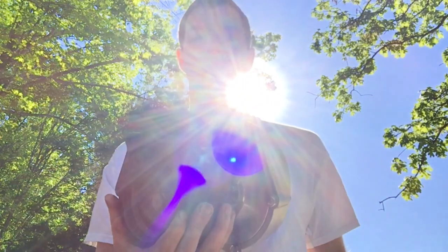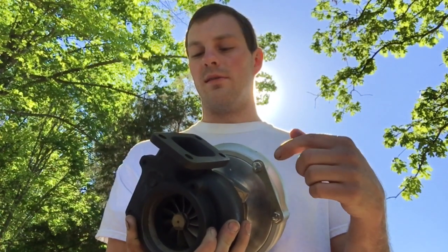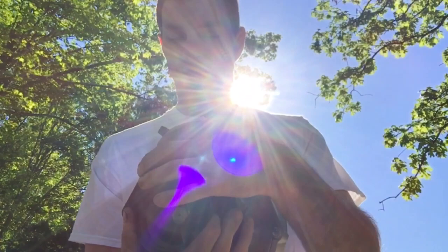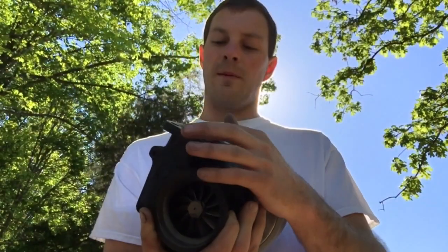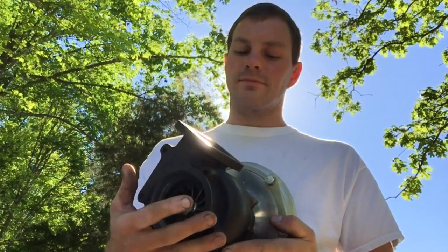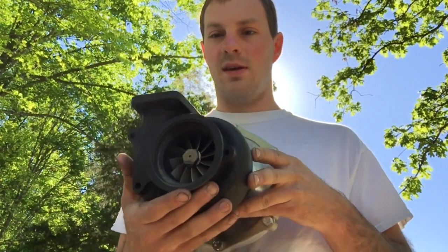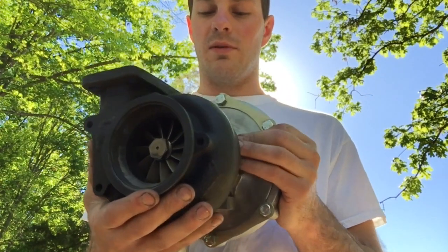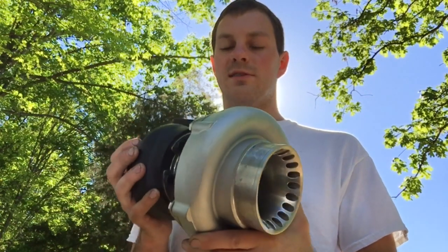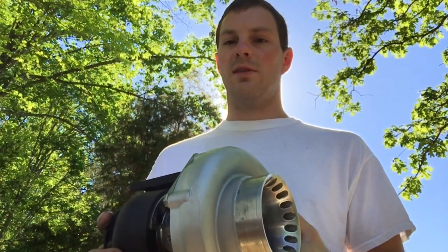To rebuild this, the turbine had got nicked up — probably from where they welded on the inside, it had some slag. I think the slag went down and hit the turbine wheel. So he replaced the turbine wheel, rebalanced the assembly, and then we replaced the bearing housing.